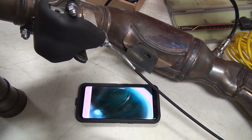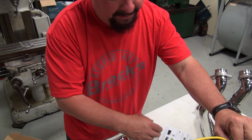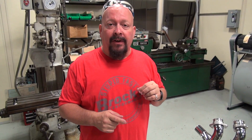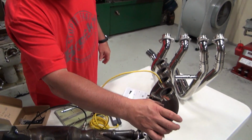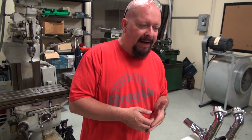This is part of another valve configuration here in the SET, Suzuki Exhaust Tuning. So, why is this relevant? Well, we got it wrong. Good news is, we've got an idea exactly what they're doing here, and I'll explain it to you. This bike has very small diameter head pipes. Small diameter head pipes are great for low end torque, they're great for mid-range, but they typically hurt peak power.